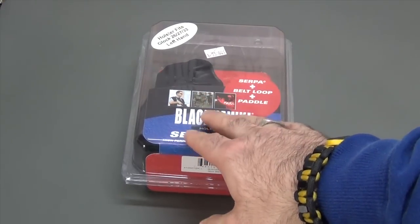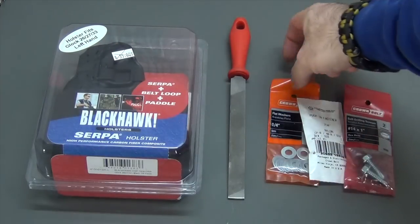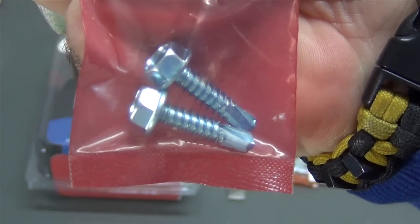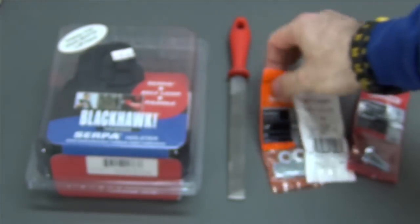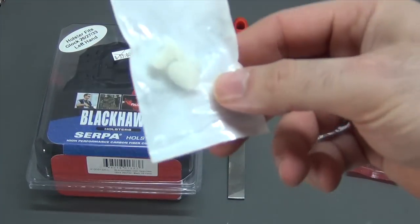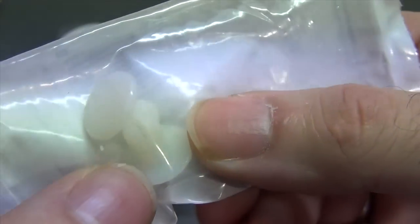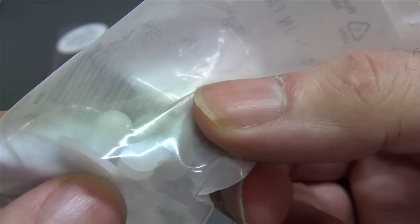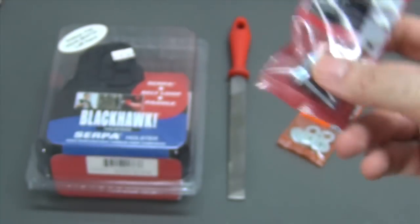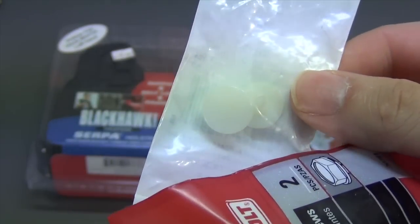The only other things I'll need are a couple of small parts: the holster itself, some screws with a heavy thread that are self-tapping and will hold well in plastic, and possibly some washers depending on how big the screw heads are. One other thing you may need later are these little caps — you can paint them to match your console color with plastic-formulated paint. If you ever want to remove this, just take the screws out, pop these caps in, and you'll never know it was installed.